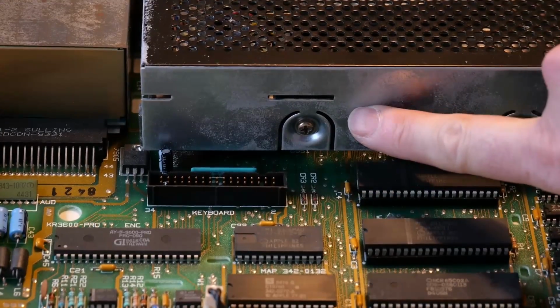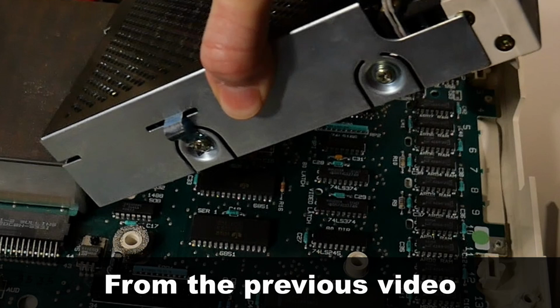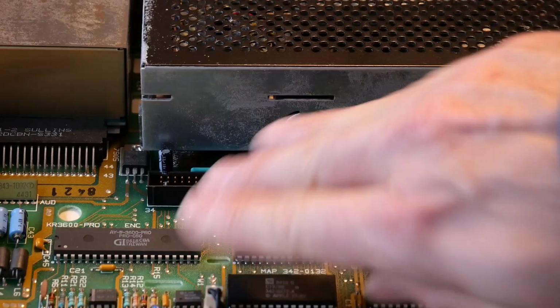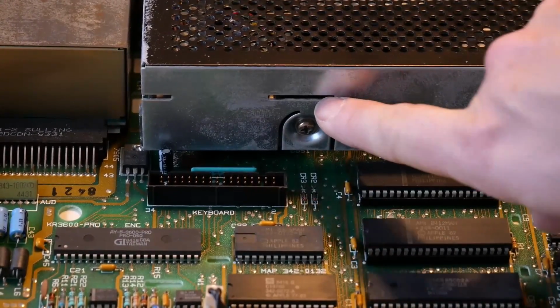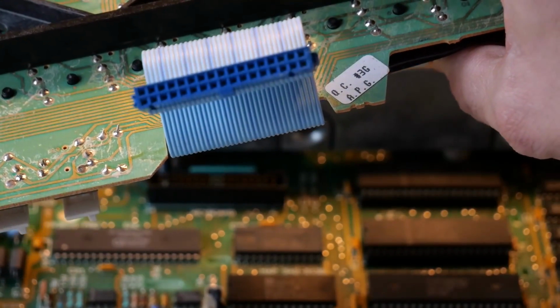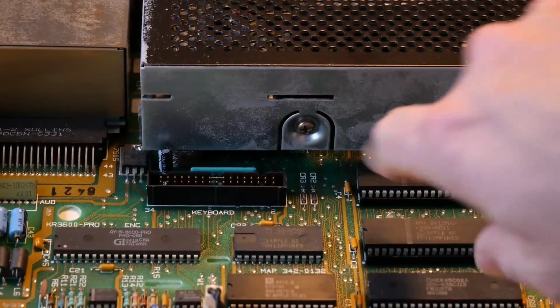In addition, this is the slot on the disk drive where the keyboard goes in, and on the Alps one, there was actually kind of a metal spring right here that I think, when you stuck the keyboard in, would ground the base plate to the floppy drive. And this thing doesn't have the spring, and on the keyboard there is no metal there, so there is no ground contact being made when you slot this in.